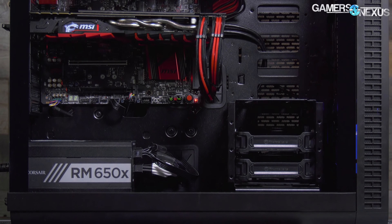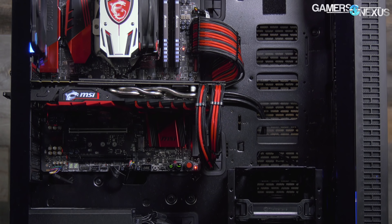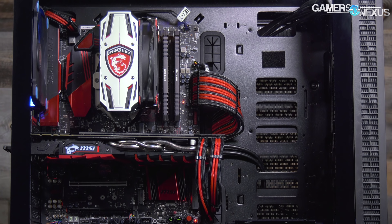The models of this case include the $110 version we have here, which comes with two 140mm ring non-RGB fans, and a $170 alternative with two RGB ring fans in the front. The layout is pretty straightforward: you can mount fans in the front — 140s, 120s, and even 200s, which we did test. If you mount 200s in the front, you can technically install those inside the chassis, which is something you could not do with the H500P. However, Thermaltake's marketing images show 200mm fans mounted externally on the outside of the chassis bars, so that's how we tested.